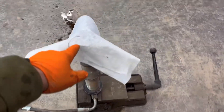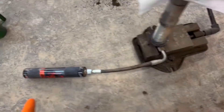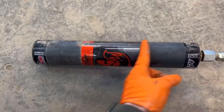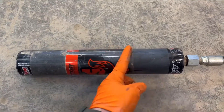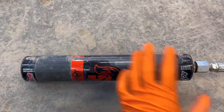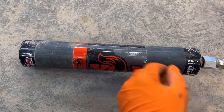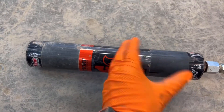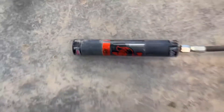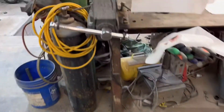The shock is just filled with oil, and then in this reservoir there's a piston that goes back and forth — nitrogen on one side, oil on the other. It's amazing that these things can seal up well enough to operate like this without letting it pass, but they work really well. It's such a slick system.